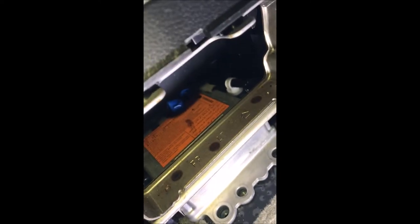There's one more bolt right there that you have to remove, and then this module is free. You can slide it out the back, unplug the airbag module connectors and it'll be free. Once you get the cover off, that gives you some freedom here — just prop this up, put a wrench there to give me some room. Then you take your T50 and go in here to the back. I'll just go in there with my hands because I definitely don't want to be taking apart my center console — it's just so much more work. There's that third bolt. This whole thing should be free now.